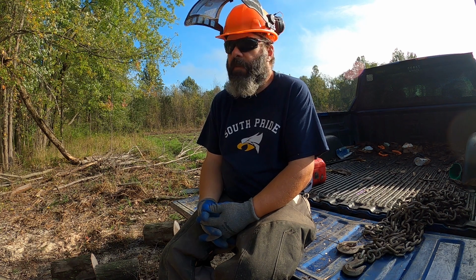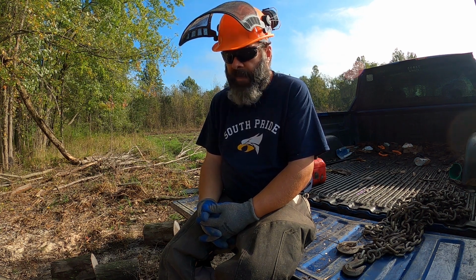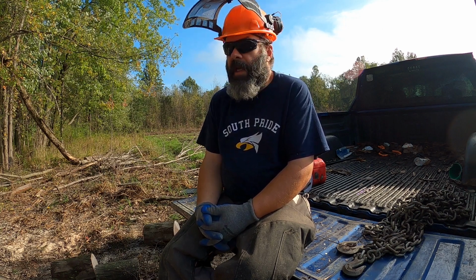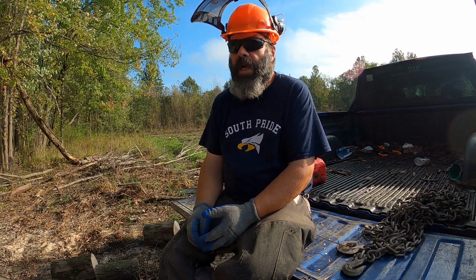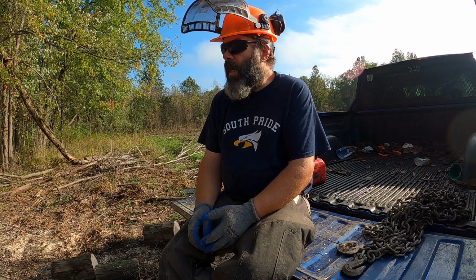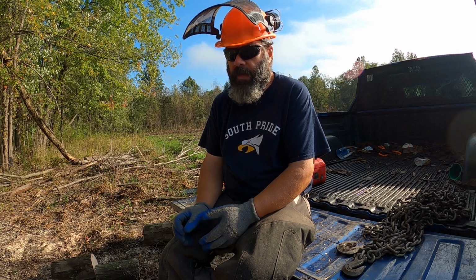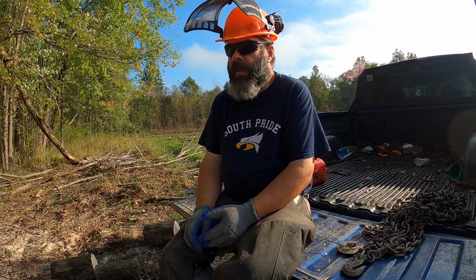I think the carburetor needs a little more adjustments here and there, and it'll be fine. It's gonna be a nice little saw. I don't think I can get enough performance out of it to say it'll touch a 545 or the 350. Those saws are just phenomenal on the chain speed. And I could not find a fine-tuning screwdriver, so next time we bring it out, I'll make sure to try to remember to bring that with me so I can put a little tune on it. And I think it'd be a great saw. The idle might have to go up just a little bit, maybe the low idle circuit played with just a little bit, and it needs more gas. It'll rev higher. I know it will.